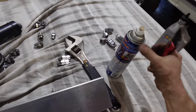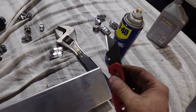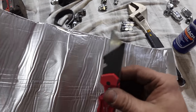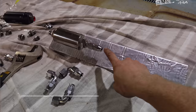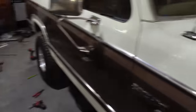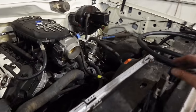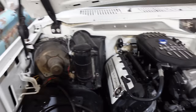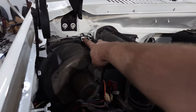Quick reminder: if you put a little bit of WD-40 on your razor when cutting sound deadening, it doesn't gum up the knife and it cuts way nicer. I've got the filter mounted, waiting for the brackets to dry on the paint. Going to run the cooling lines — there's just 5/8 coolant heater hose that goes from one side and the other side, up nice and neat to the heater core.